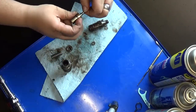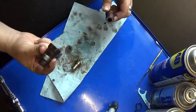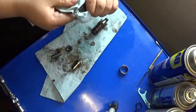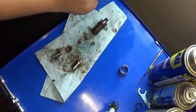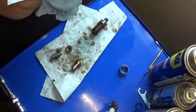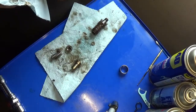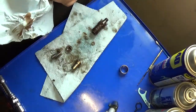These are the injector body parts. I'm going to pretty much be quiet now and you can watch me clean out this stuff. Make darn sure that you've got a lint-free cloth and an extremely clean work surface. Actually, this is not a clean enough work surface, to tell you the truth. They want you to have pretty much a surgical operating room style of cleanliness.